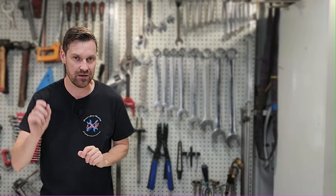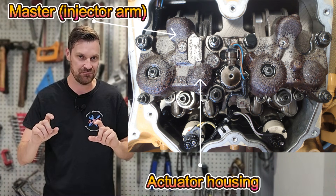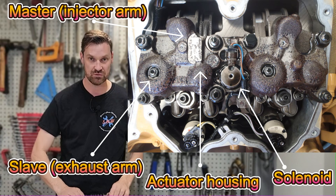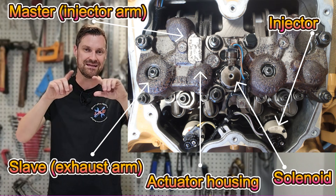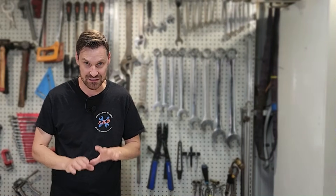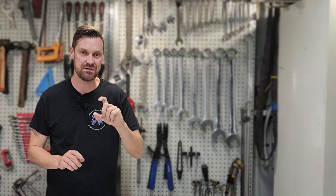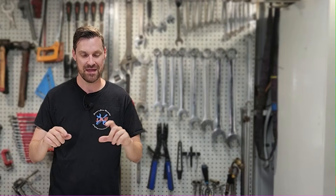So how does the jake brake actuator work? It is a manifold that sits on top of the valve train and it has a master piston and a slave piston, with a solenoid between them. When we turn on the jake brakes we switch off the injectors and activate that solenoid. When the solenoid is open, engine oil pressure flows into the jake brake actuator and allows the master and slave piston to be hydraulically linked. When the unit injector rocker arm rocks over to actuate the injector, it is also actuating the master piston, which controls the slave piston on top of the exhaust valve — so where we'd normally have injection, we now have an exhaust valve opening. Turn the jake brakes off, the solenoid closes, oil pressure drains out of the actuator, the master and slave piston are no longer linked, and the jake brake is switched off.